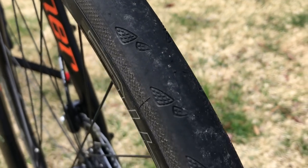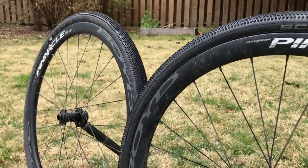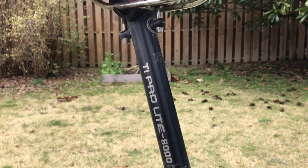The rear cassette is an 11-32 tooth, which gives me plenty of range even for gravel racing. I love single-chainring setups on my mountain bikes, but for gravel racing I have a hard time giving up that top-end gear. For tires I run the Schwalbe G1s for gravel, or wider Specialized 1.8 Renegades for chunkier Pisgah gravel, but the vast majority of the time I just run 25mm Conti Gatorskin road tires because they're reliable and I never flat on them. For racing, the biggest swap is wheels — I'll run deep-section carbon wheels like the Boyd Pinnacles for improved aerodynamics and weight savings.